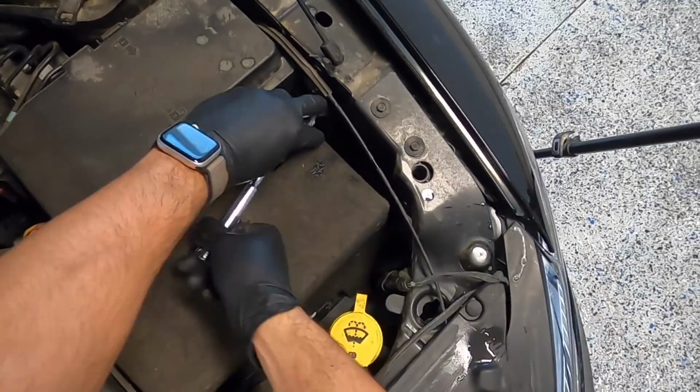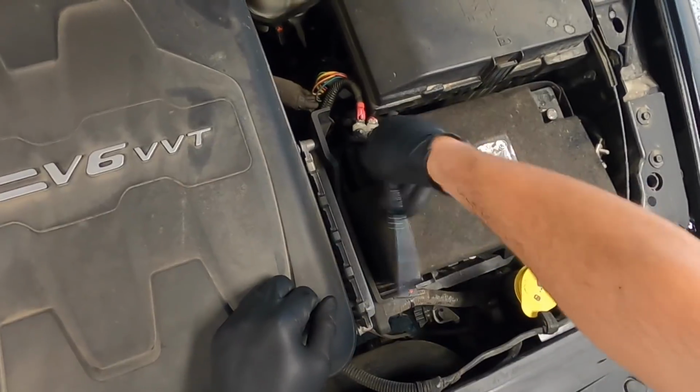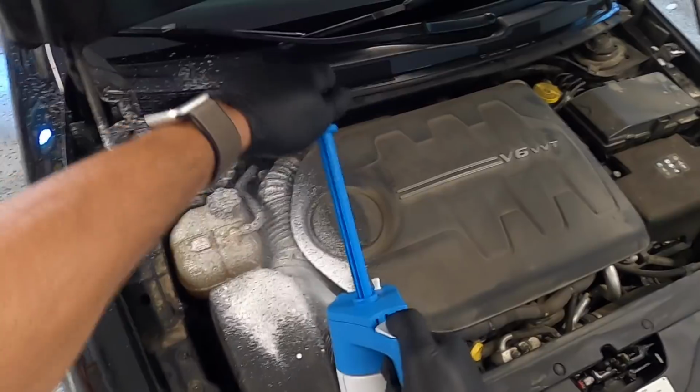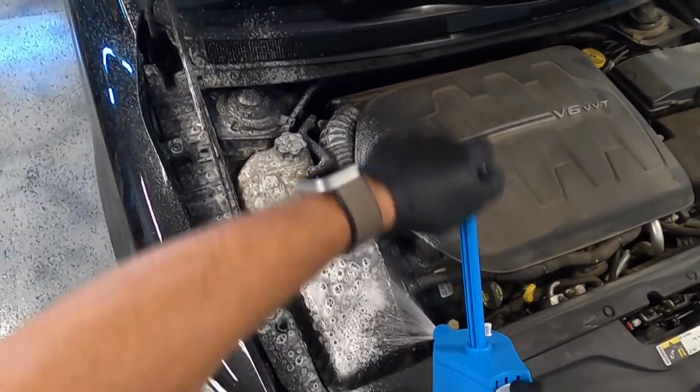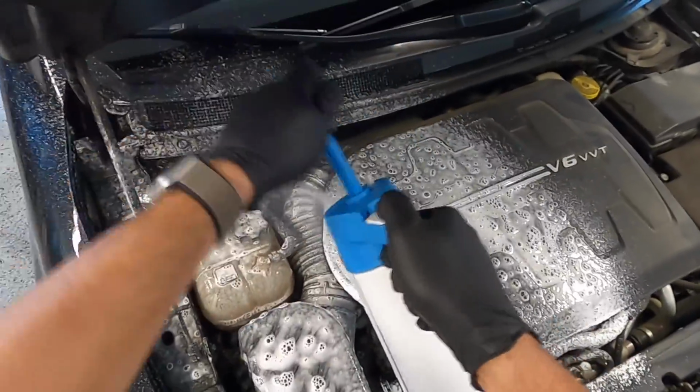And getting started now, the very first thing you'll need to do is disconnect the vehicle's battery. And one thing to note is that you always want to disconnect the negative terminal first, and once that's done, I'll spray on a very liberal amount of Super Clean degreaser using my IK foamer, making sure to cover every surface in here.